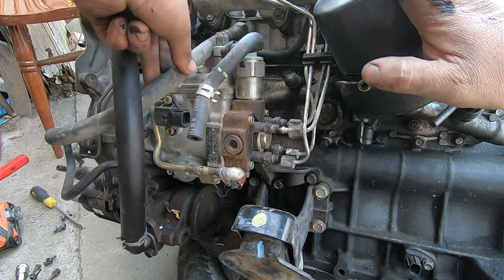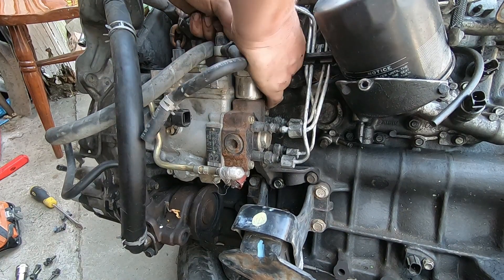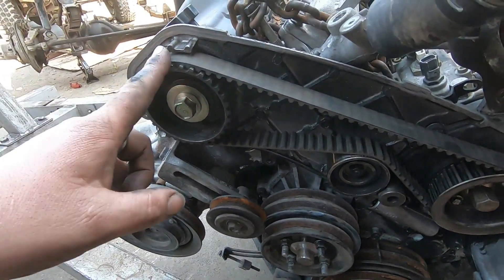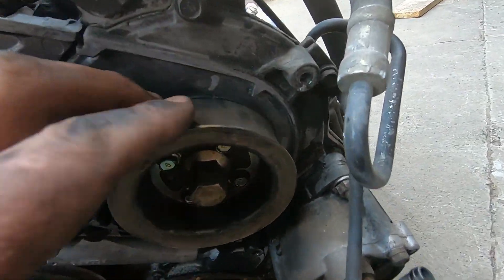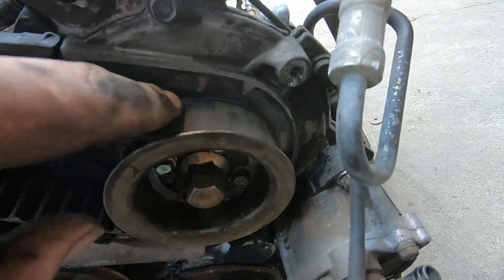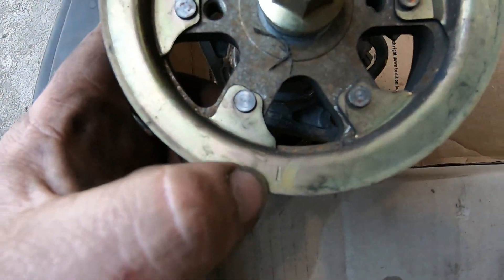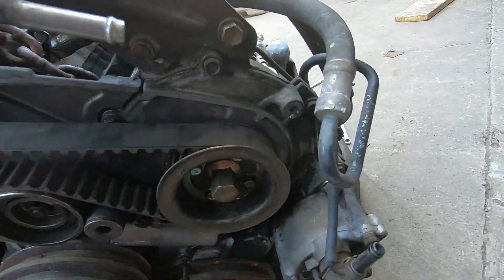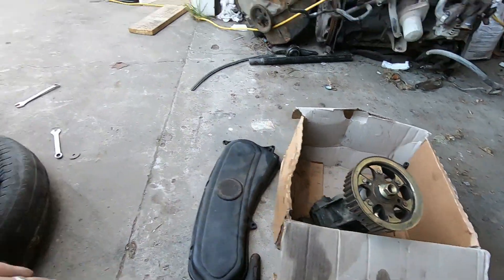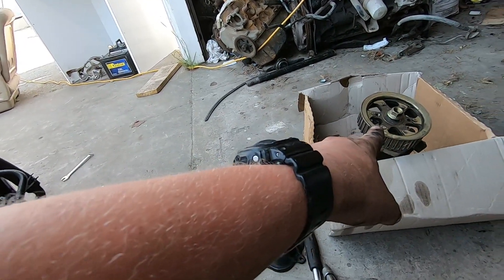With those loosened off we'll just pull them back. What else have we got to undo? There's a fuel line and probably a return coming back here — we'll pop that off with a 24 mil. I've just turned the crank, which has turned the cam, which has resulted in the injector pump timing turning as well. I've rotated it until there's a little line that matches up with a white line pre-drawn on there by someone in the past. So when I put the new pump on I'll line it up the exact same way. Looking at the pulleys though, that gear looks far bigger than this one.